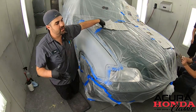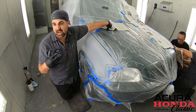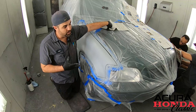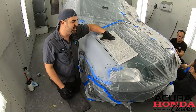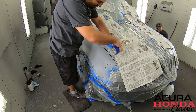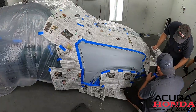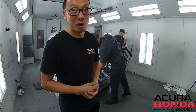Before we spray base coat — remember how I told you earlier how that plastic can kind of flake off when new paint comes on it and the pressure and air from your new paint can just really lift up that old paint right into your fresh paint? Here's what we're going to do: we're going to cover it with newspaper around all of our edges. That way this paper is going to hold the overspray a lot better. We put a newspaper on the plastic and Ryan is about to spray base coat on it right now.